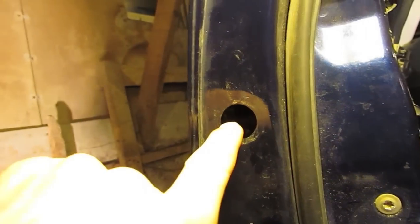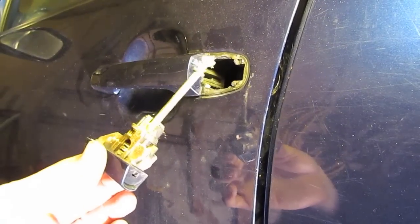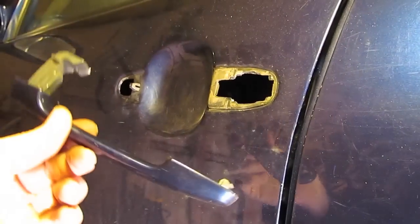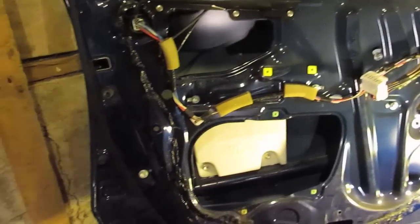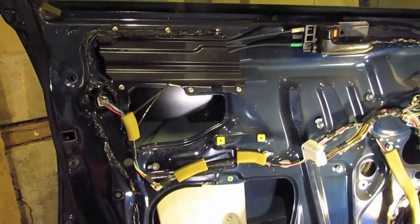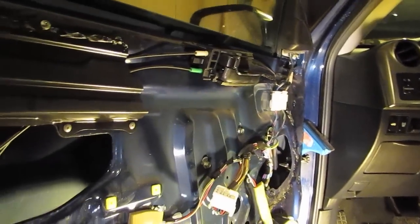With the Torx head screw removed, the lock cylinder will simply wiggle and you'll be able to pull the whole lock cylinder right out of the door. At that point the handle assembly simply slides out — and there's your door handle, two screws and a couple pieces of plastic. With the lock assembly out, be careful: if the door shuts you won't be able to open it from the outside or inside because everything's taken off. I recommend taking something soft and placing it in the door jamb as a precaution to keep the door from shutting.